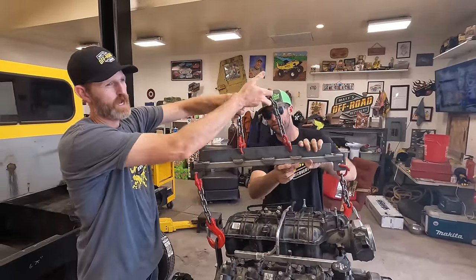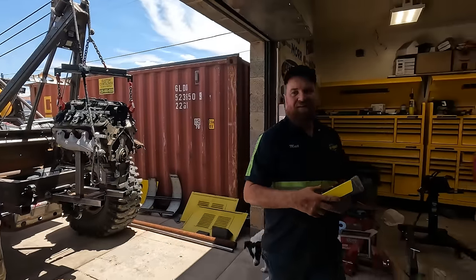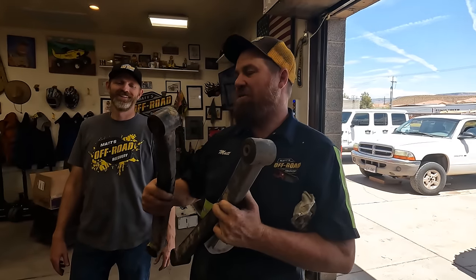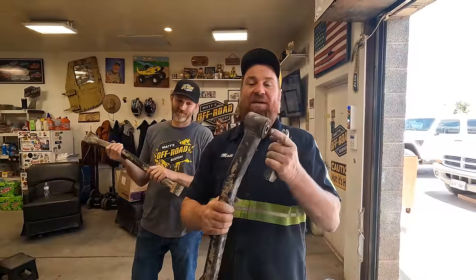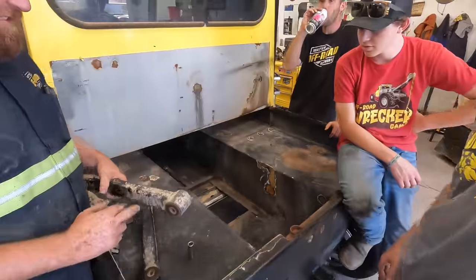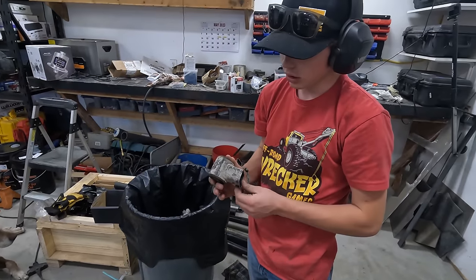Oh yeah, we're ready for you. Look at that. I think it might just barely be high enough. It's going to be close. Whenever somebody upgrades their Jeep suspension, I swoop in there and snatch these out of the trash because they just throw them away because they're not good for anything anymore. But I love them for motor mounts. These are very durable, long-lasting motor mounts, and they're cheap. So Rhett, I need you to cut these off square. A little less than 2 inches.